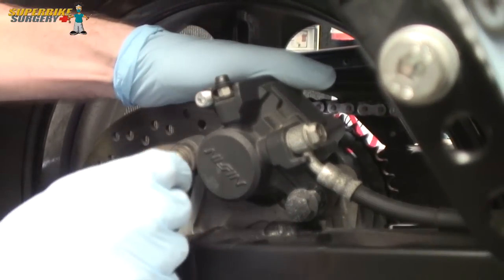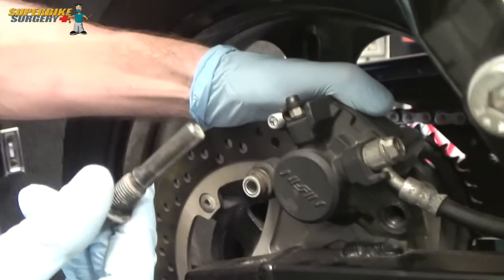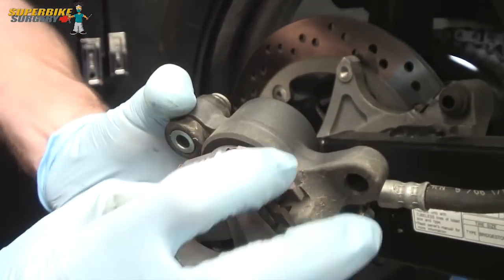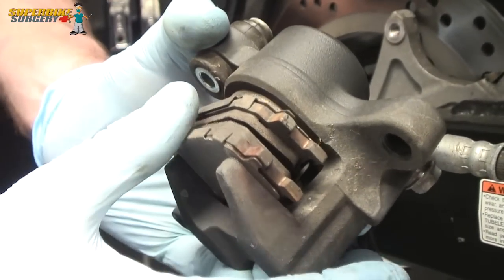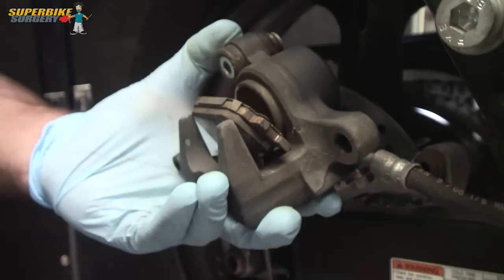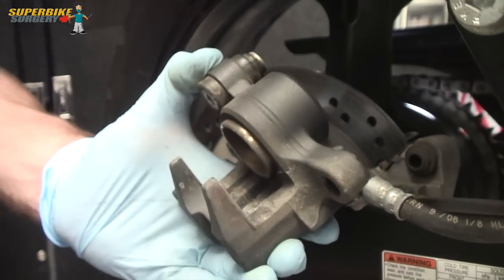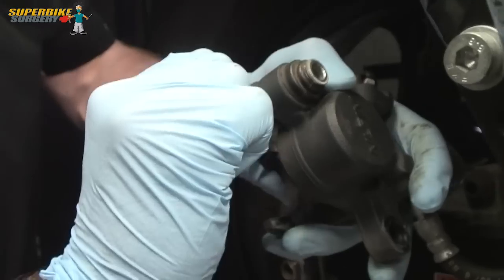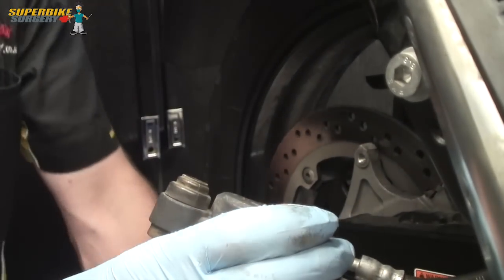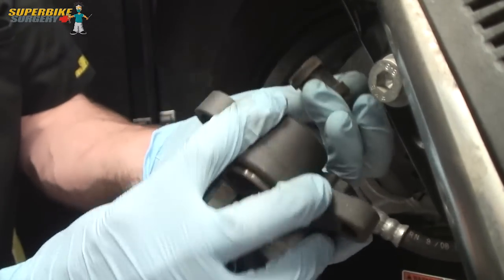The two retaining bolts with this type of calliper: one of them is just a standard bolt, and the other one is threaded on one end but it's actually the pin that the calliper pivots on on the other. We remove those two and slide the calliper up and off to reveal the pads. Loads of meat on the pads again like with the front. We remove the pin that holds the pads in and then remove the pads. As with the front calliper there's an anti-squeal shim in there, and there's also another sliding pin with two rubber boots. We release it from one side, push it through and pull it out.